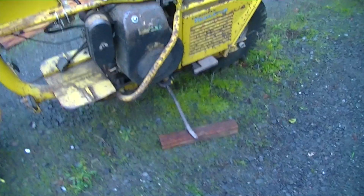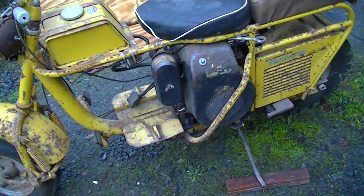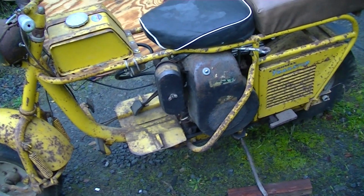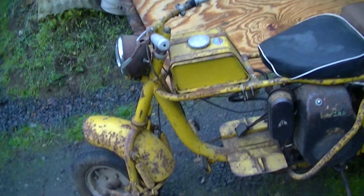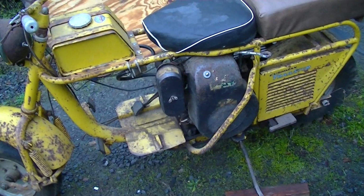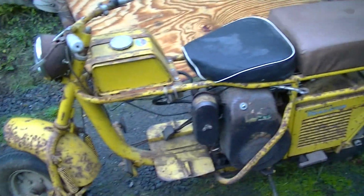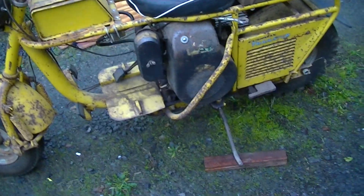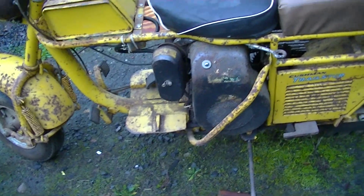Of course, we'll go through the ignition magneto, give it points and condenser, set the timing and the gap right, give it a new plug, clean the carburetor, give it service if it needs it, and we'll clean up a little of the cosmetics on this cowl, I guess, while we have it out. Give it a new air filter element, and put it back in the bike.